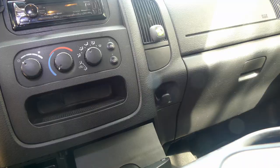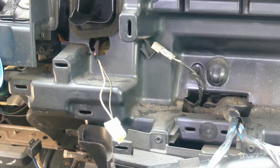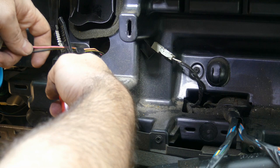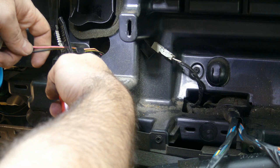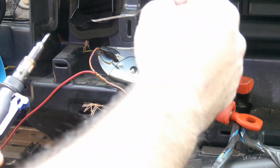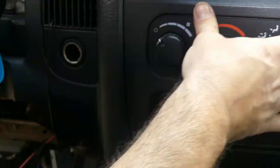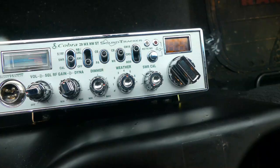While I'm inside the cab still, I'll start running the power and ground connections. I'll need to remove this trim panel to access the back of the cigarette lighter next to the steering column. This lighter is key-on power only, so that'll ensure I can't leave the radio on when I get out or overnight. Now I can tap into the power and ground for the lighter. The harness I'm using on the radio has its own fuse, so each circuit will still be protected. Time for my favorite part — let's do some soldering. Wire is secure, let's put the panel back on. I fished the new harness extensions through the underside of the dash so I could get it back over to that trim panel and run the cable underneath the carpet again.